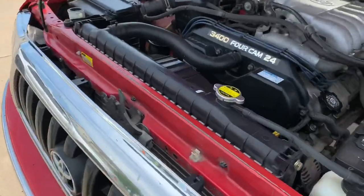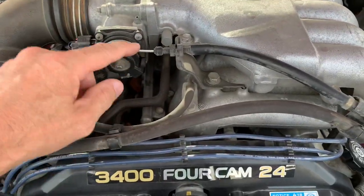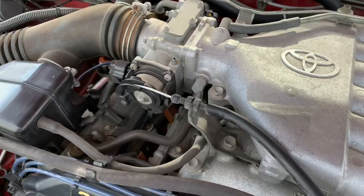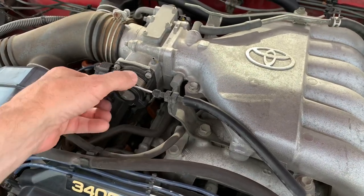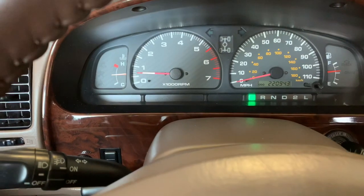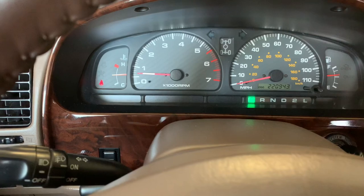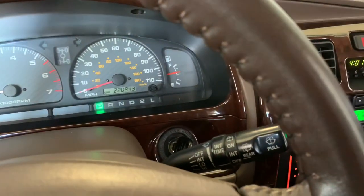Here's the 2003 Tacoma. You need to have a little bit of play in there — the acceleration response is pretty good with this, so I don't think I'm going to adjust it. I'm going to leave that little bit of play in there. We're sitting right at 700 RPMs for the idle, fully warmed up, with the air conditioner not on.